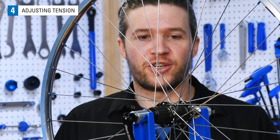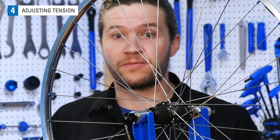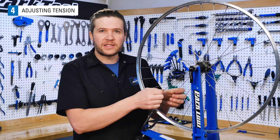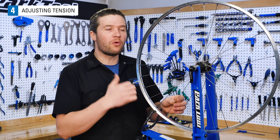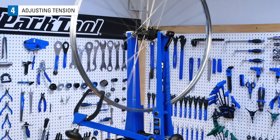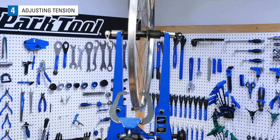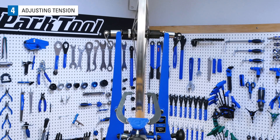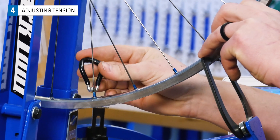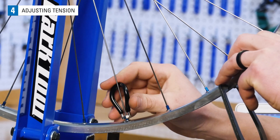When adjusting a wheel's tension, our number one goal is consistent spoke tension, or what we call good relative tension. On this wheel, we measured and they were a little bit inconsistent from spoke to spoke, but overall they were a little on the low side. To correct this wheel, we want to raise its overall tension. Since this is a rear wheel with different bracing angles on each side of the hub, increasing tension may change the dish slightly. With that in mind, let's give the spokes on the drive side one quarter turn each, and those on the non-drive side one eighth of a turn to start.